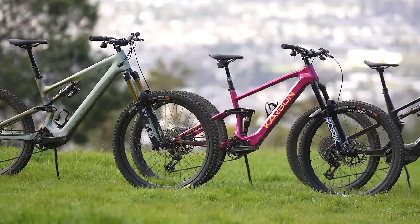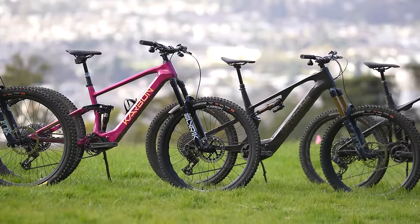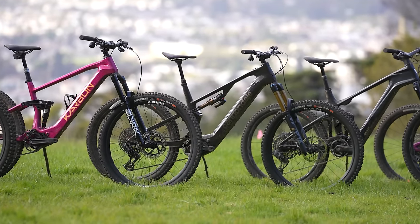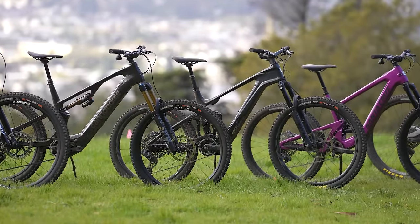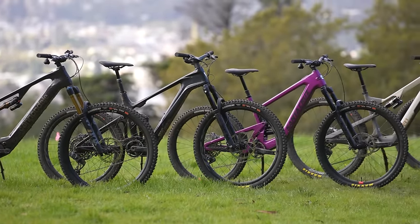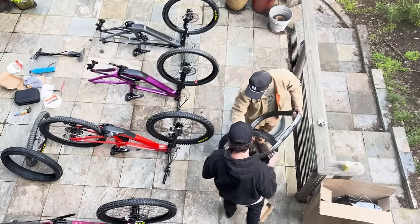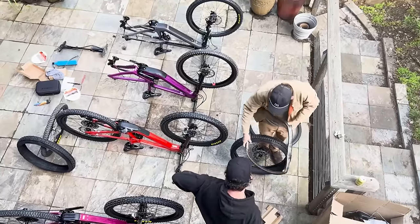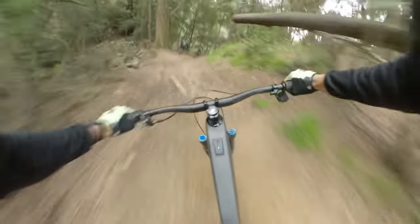In our group of test bikes, we had rear travel ranging from 140 to 160 millimeters, battery size range from 320 to 601 watt hours, motor torque range from 50 to 85 newton meters, retail price range from $8,000 to $12,000, and weights range from 41.6 to 46.8 pounds. All of the bikes tested fall into the e-trail bike category based on travel. However, geometry varied quite a bit between bikes, creating a broad spectrum of strong suits and intended uses. Some bikes favor descending performance or peak motor output, while others look to achieve the lightest weight for increased maneuverability.